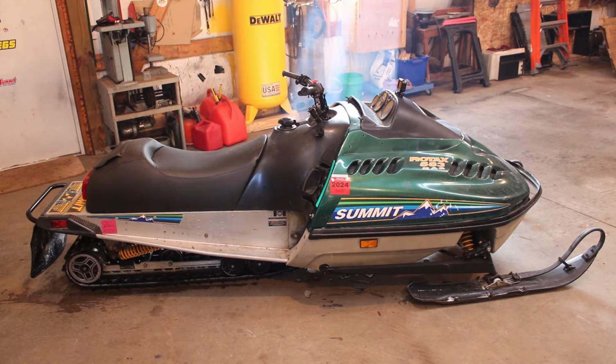Like I knew the coil was good because I could find those specs online. But as far as voltages coming out of what wires and where, there's really nothing that I could find. I'm sure maybe it tells you better in actual service manuals if you were to buy one. But the best thing I could find online was just telling you where to attach the Bombardier specific test meters to which lines and where and what you should set the meters to and stuff like that. Nothing generic that you could just check with a regular DVM.